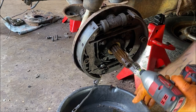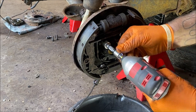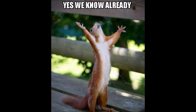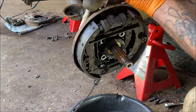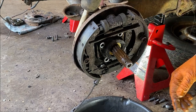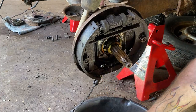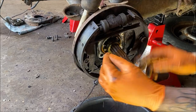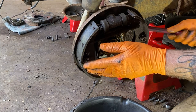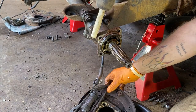Let's get the other side apart. We are at the passenger side. I'm going to snip this brake line since I'm replacing all that stuff with new. Remember, you're going to have fluid coming out more than likely. Remember the way this stuff came off — stack it in your cap. Set the backing plate in the pan; you're going to have a little oil dripping.